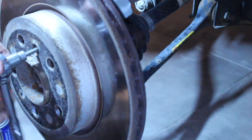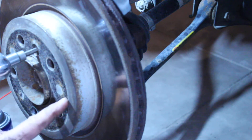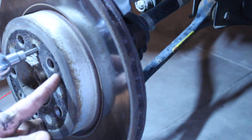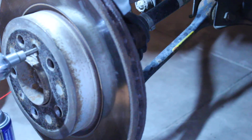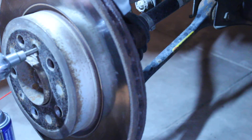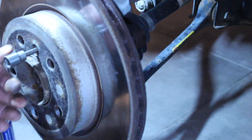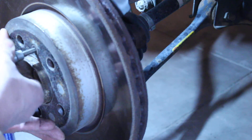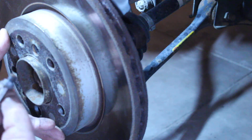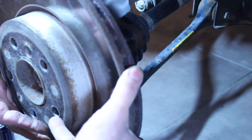Okay, here's the reveal - you can see the brake rotor comes away. Notice you can see the signature of where the rim sat on the hub of the rotor. When I reassemble, I normally put anti-seize on these surfaces as well - it just lets the rim release off a little nicer. If you ever get a flat and need a roadside wheel change, you'll be so happy that wheel comes off easily, because the alternative is going to make you really unhappy at the side of the road in the rain in the middle of the night.